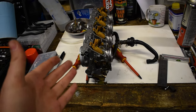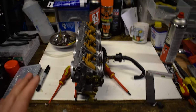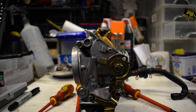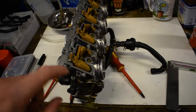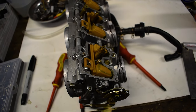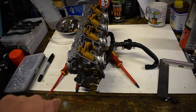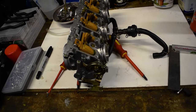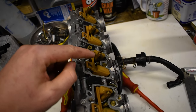This is the original Suzuki service manual that I'm following. 45 degrees like so - roughly, I think it's about 45. I have it balanced on some screwdrivers and the reason for that is so that it kind of sits on the pin correctly. Obviously if you have it too low you're going to have too much fuel in there, and if you have it too high you're not going to have enough fuel in there.